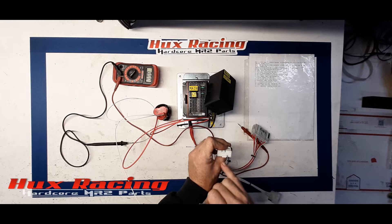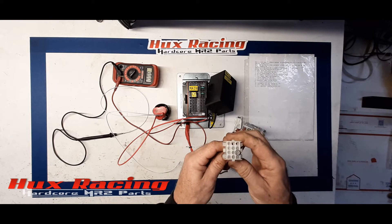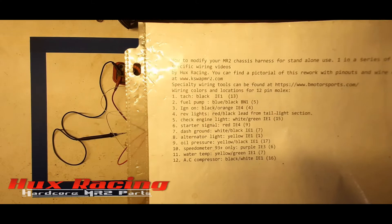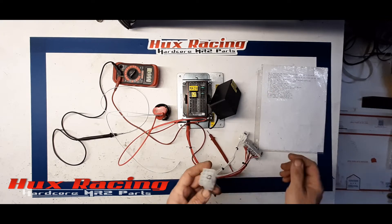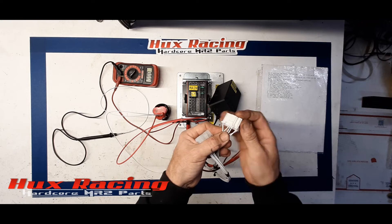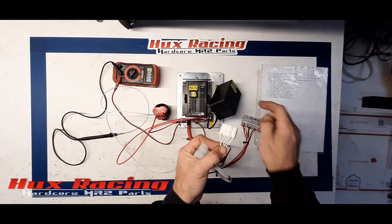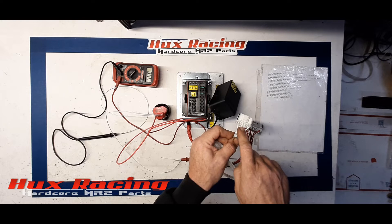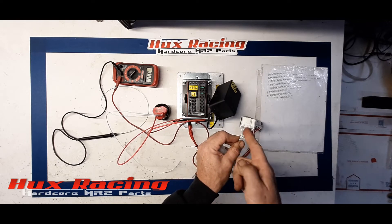Now what's going to tell the ECU to command the ground trigger is this 12-pin Molex — earlier versions would have used a Metropak connector but I still would have used the same pin numbering. By applying 12 volts to pin 3, that runs all the way to pin 9. So 12 volts to pin 9 on the K-series E-connector will command the ECU to latch the main relay — it will apply ground to pin 7, latching the main relay. If the ECU is not powered up and you back-probe this connector, you'll see 12 volts, but that's just the voltage coming across the main relay latching circuit. Once the ECU commands the relay to turn on, that becomes a ground signal.